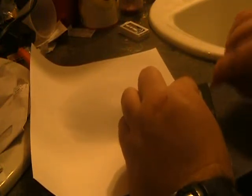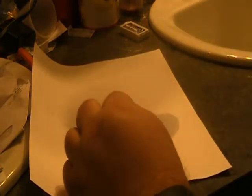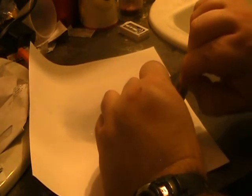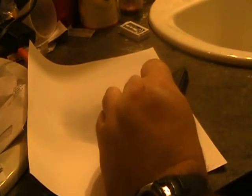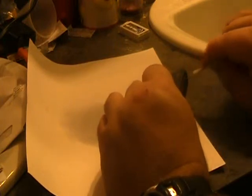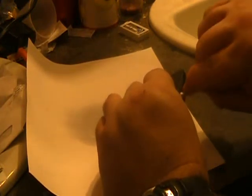I'll show you the technique slowly. Put the q-tip in as far as I go and do one swipe. See, I got some dirt — you don't want to put that dirt back on, so you turn the q-tip upside down so the dirty side faces up and the clean surface is touching the contacts. And I got more dirt again on that clean side. Then for the dry end, same technique — if you pick up a little dirt while drying, turn it over.